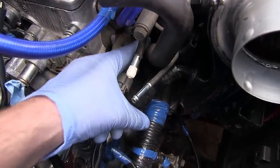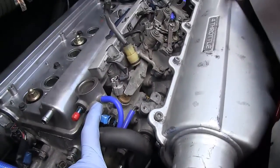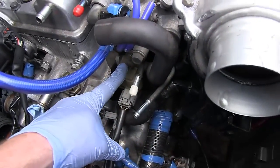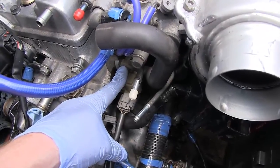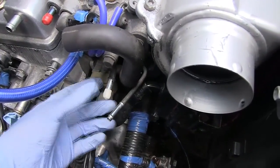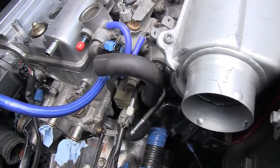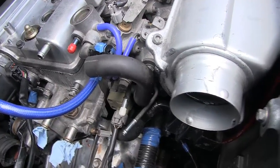As you can see here, there's a big black tube that comes out and it goes into the intake manifold here. This is the air bypass, and this is to increase your revs when your engine's cold so that you warm up the engine faster. Then as the engine gets warmer, this thing should start to close and you don't need that extra air bypassing the throttle to artificially increase your RPMs.